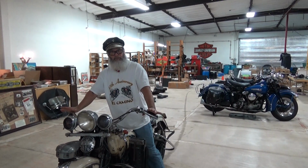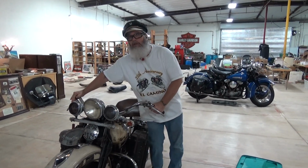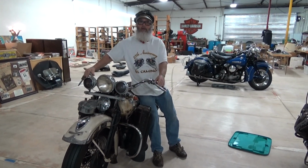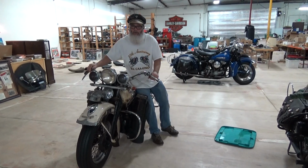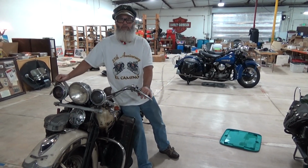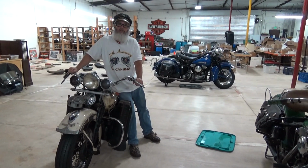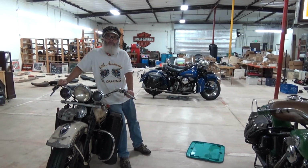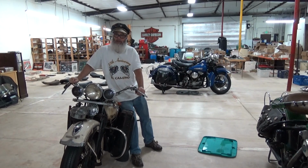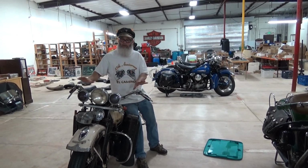Kickstand up. Okay? You get off the motorcycle. And there's 3 ways to do this. Number 1, you sit on the seat and you push it backwards or forwards with your legs. You steer with your hands, but you're pushing with your legs. You can take a little 5'5" girl and put her on a 700-pound hog, and she can push it around because you're using your legs. You lean it into yourself. Don't lean it that way, you and the bike will fall over.